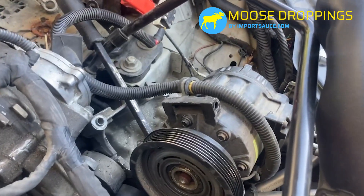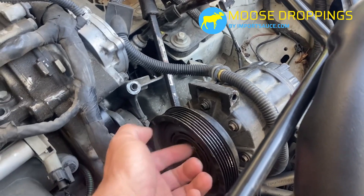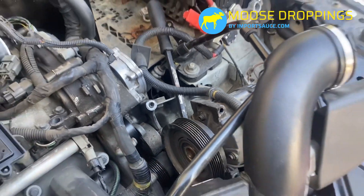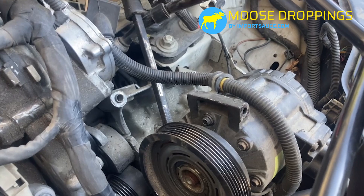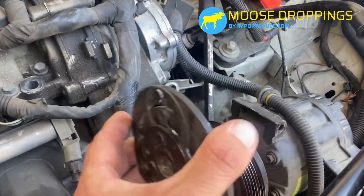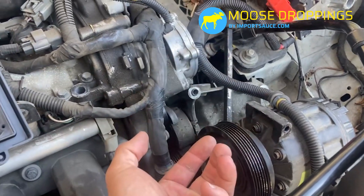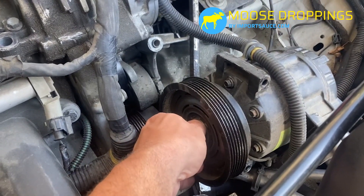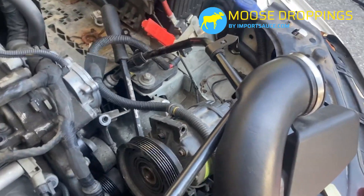When your vehicle is running, this pulley is spinning freely — the electromagnetic clutch inside is not engaged, so off the belt it's just spinning all day long. There's a giant electromagnet in there, so when you push the AC button, it sends power to that magnet. What happens is that magnet will pull this face plate in, and that sandwich then engages the inside, which is now spinning as well. That splines all the way down and makes your AC compressor go.